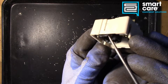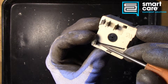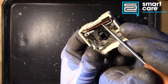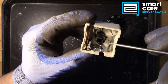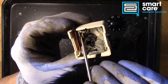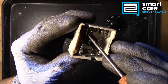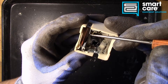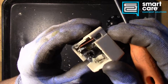There are a few ways infinite switches can fail. The first is the electrical contacts burning up. Every time the contacts open and close, there will be a very small electrical arc, and these contacts will eventually pit and won't pass current when they come close — they'll have too much resistance. That resistance can also build heat and cause the outer casing to get brittle, crack, or melt.